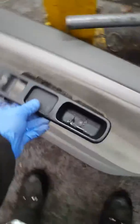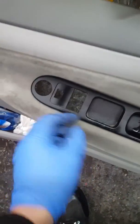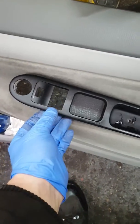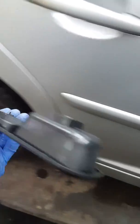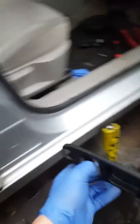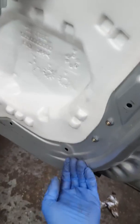You're going to need a couple of plastic tools so you don't scratch the cover. Take the screw out, then get those plastic tools under it and just pull it out — it will come out. It's just a couple of plastic clips holding it in. Once you're removing the door trim, it will be attached to the cover, so get the plastic tools under the cover and start pulling it out.